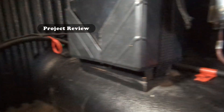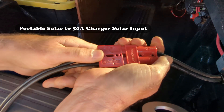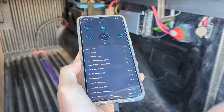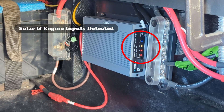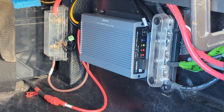Here's a review of what we've done. The starting battery is connected to the 50 amp charger via the red wire. The charger output is through the brown wire, which goes through the 100 amp fuse and then to the battery selector switch. Let's turn that switch to the 50 amp hour battery that runs our fridge and give things a quick test. First, we'll plug in our 400 watt portable solar panel to the charger — it detects the solar input and is charging the 50 amp hour battery at just over 8 amps. When we turn the engine on, the charger pumps that up to 25 amps. Now let's switch it over to our house battery bank — we're charging at nearly 32 amps. This is some of the fastest charging we've ever seen on our small system.